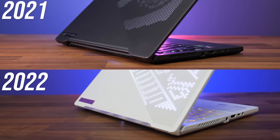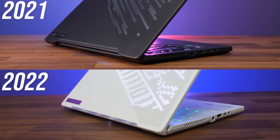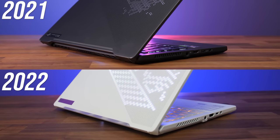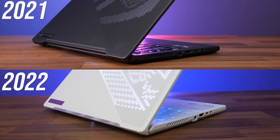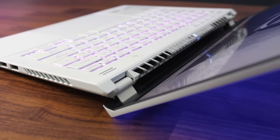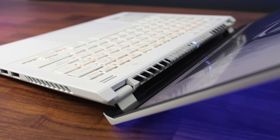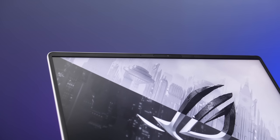There's just so much change here — you're definitely going to want to make sure that you're subscribed for my upcoming benchmarks and full reviews. The screen change to 16:10 also means there's no longer the V-shape cutout underneath it, which was there to let air go under the lid, but apparently ASUS didn't find that to help too much, so it was removed in favor of the bigger 16:10 screen. Hot air still exhausts below the screen, though the vents are angled out to the sides to reduce hot air blasting the screen.